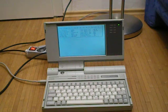Well, the problem with this thing was the buffer battery is empty, or CMOS battery, or BIOS battery, or whatever you want to call it. I think it was still called CMOS back then, not BIOS. But apparently it's working. Yeah, that's working. So I correct my statement that this thing does not boot. It does boot, but it lost all the information I put into it when the CMOS battery drained.